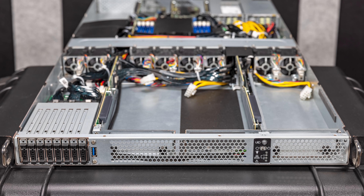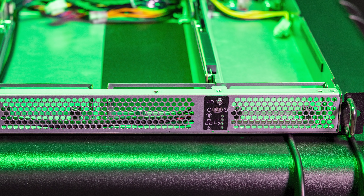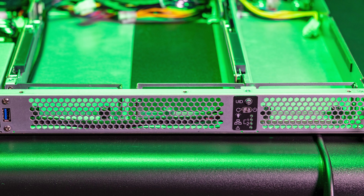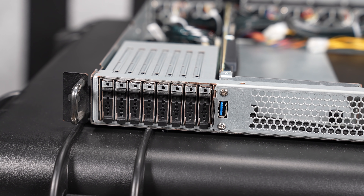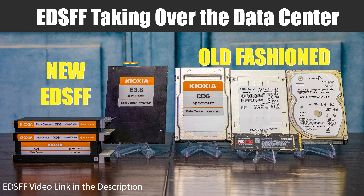Let's look at the front of the system. There are really two sides to this — one of them is quite boring, and one of them is super interesting. The boring side is the fact that there is a giant portion of this front panel, this 1U front panel, that is basically just air holes and air vents for air to pass through. But on the other side of the system, we see something completely different and absolutely awesome. Specifically, this system is designed to take up to eight EDSFF next-generation form factor SSDs. We recently did an entire video about all the different EDSFF form factors — E1S, E1L, E3 — and we'll link that video in the description.